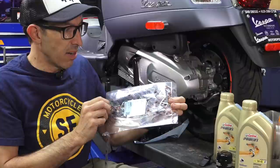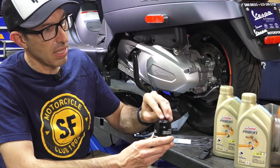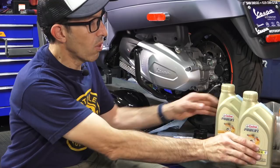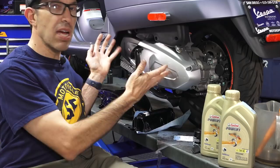Since you're pulling off the oil pan, you'll need an oil pan gasket — these aren't intended to be reused; part number on ScooterWest.com is 846-098. You'll also need the oil filter, the o-ring, and two quarts of fully synthetic 5W-40 oil. Castrol is the original equipment oil for the modern Vespa — we have several brands available at ScooterWest.com.